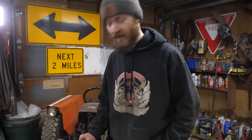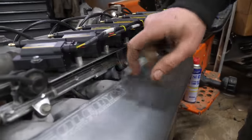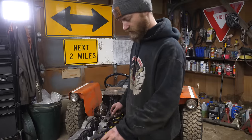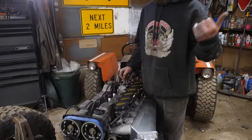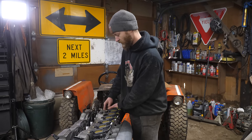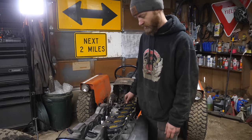It took a minute but we got the coils mounted — got the mount plate bolted on with three bolts, all six coils on there, all plugged in with their wires, all zip tied in nice and pretty. I'll get started making an injector harness out of the injector harness off one of the 2JZs. That'll have all those wires come out back here and then we can tie those into the Haltech harness, but that way we'll have all the little clips for the injectors.